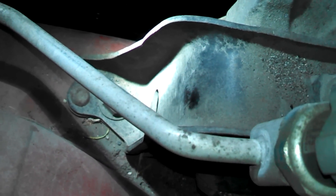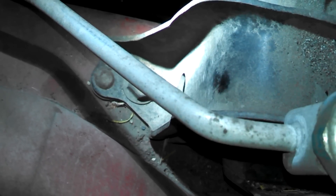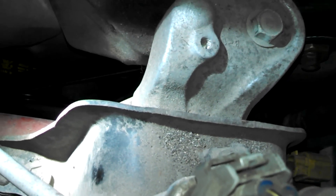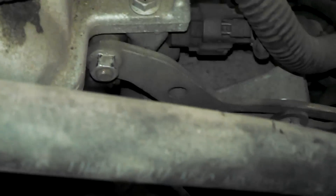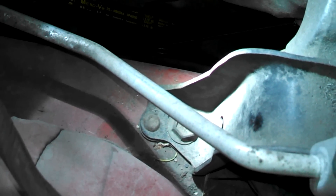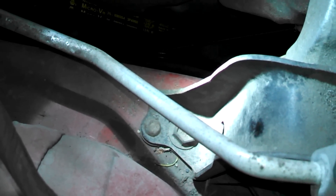It's not a great shot, but you can kind of see how tight the belt needs to be. We'll tighten up this nut and we should be good. Go ahead and start it up and listen for any squeaks. If you seem to have a belt squeal, go ahead and tighten up the belts a little bit more and do that until the squeal goes away.